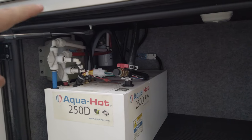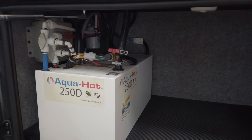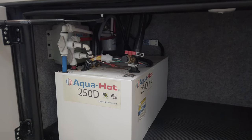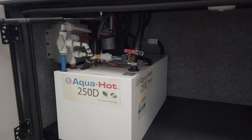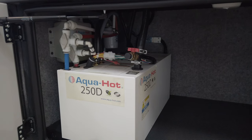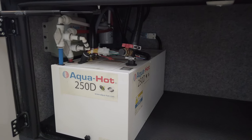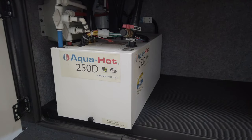You've got your coolant reservoir up here to the left and your fuel filter in the back right. The biggest thing about AquaHot — they work great. Some people say negative things about them, and it's usually associated with not servicing them. I'm a once-a-year service person for my coach — generator, main chassis engine, and any other annual stuff, always in March. AquaHot the same way. Also key: in the summer months on the heater side, use it for 15 to 20 minutes just to cycle the system so it doesn't get fuel in it that's aging. If you do those simple things, AquaHot systems work very well and are really reliable.